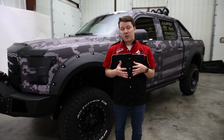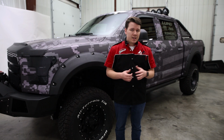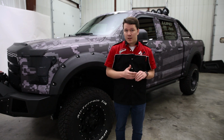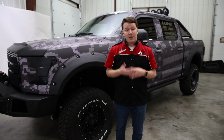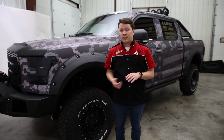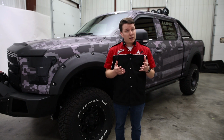Now this was a very, very involved installation, so if you have any second thoughts about doing this yourself, take it in like we did to a professional installer and have them take care of it for you. Now after you do any sort of lift to really any vehicle, it's a good idea to have the front end realigned to compensate for all the changes that you made in there. So just know that when you do finish the installation on something like this, get it realigned.